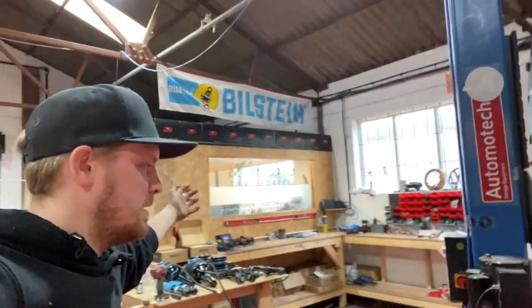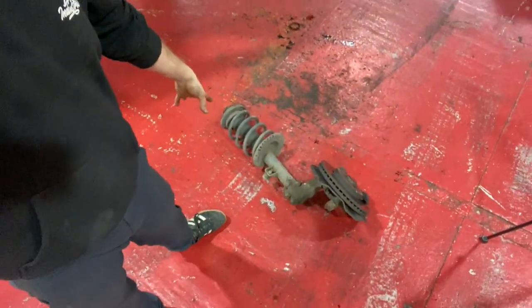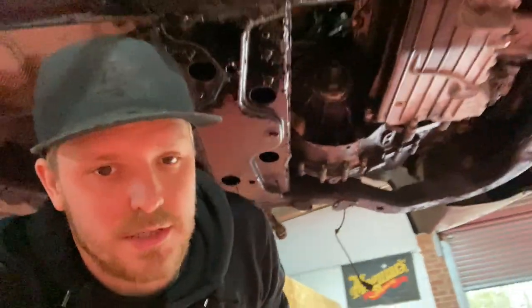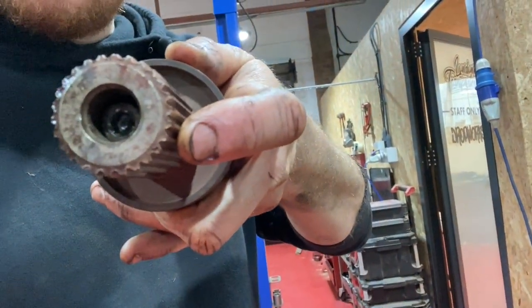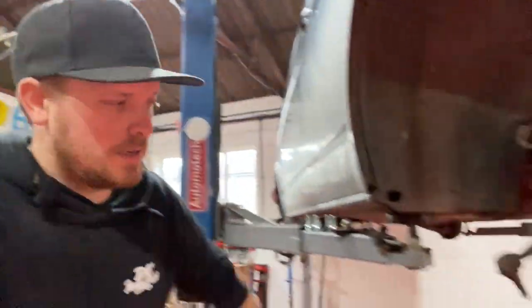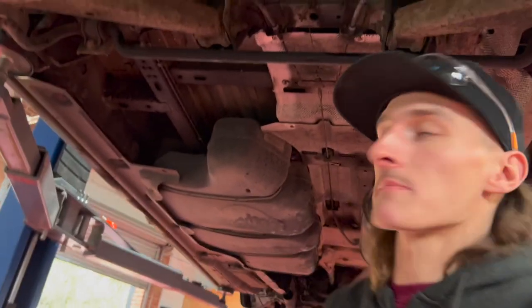Trying to get a standard strut out of the hub is too long — you can't do it. Take the hub off if you can — it's easier. So we've made a bit of progress. Dan's been focusing on getting all the air ride stuff sorted. I've got the new lower arms and drive shafts to fit so we've taken the full assembly out of the van for ease of everything. I've also changed the stub shaft, which is the most common thing that goes on them and wears — and looking at this one, it is really really worn. That should have a flat on the top of it.